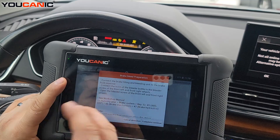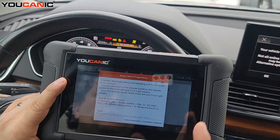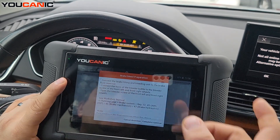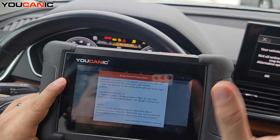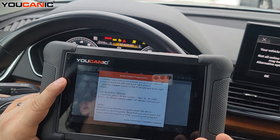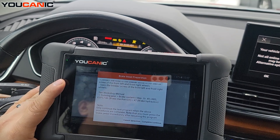You'll hear beeps as well — that's normal. You might get a fault code that shows up on the instrument cluster and the ABS module, but once you've completed the ABS bleeding procedure you can go back to the ABS module and clear the codes. I haven't connected anything to the front or rear brake bleed screws so I won't continue further, but you get the idea. Make sure you follow these instructions very carefully — thank you for watching.